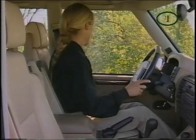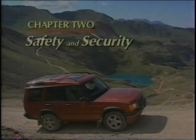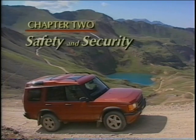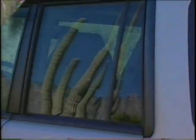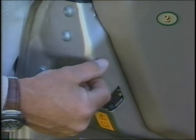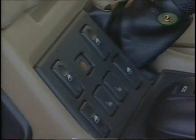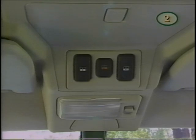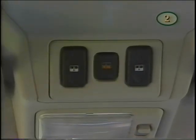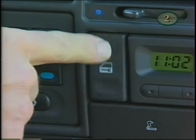There are other safety features engineered into Discovery. There are child locks on the two rear doors to prevent opening from the inside, and on the cargo door as well. To lock out operation of the back windows, press the switch on the center console. Sunroof operation can be conveniently locked out with the switch located with the master sunroof controls. All doors can be locked and unlocked with the central door lock switch.